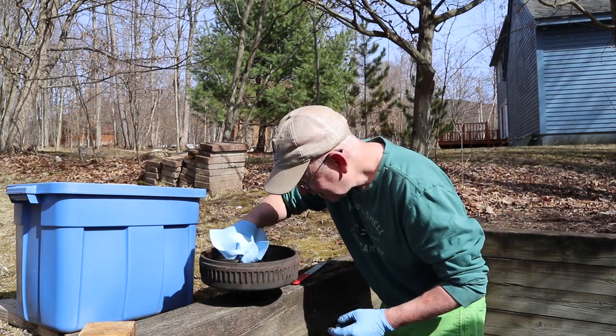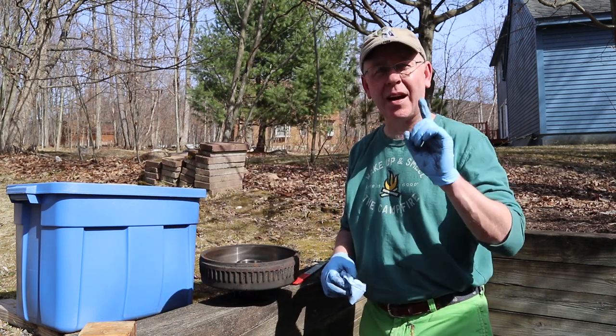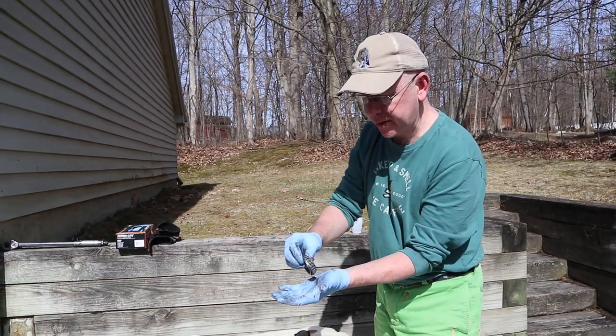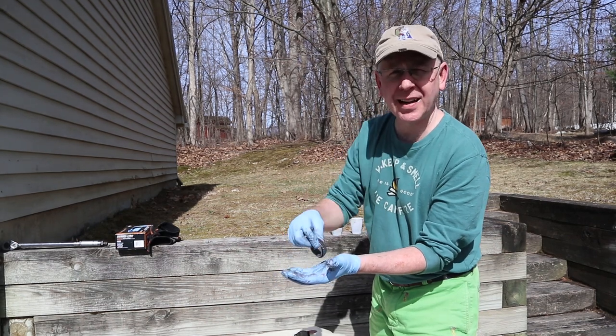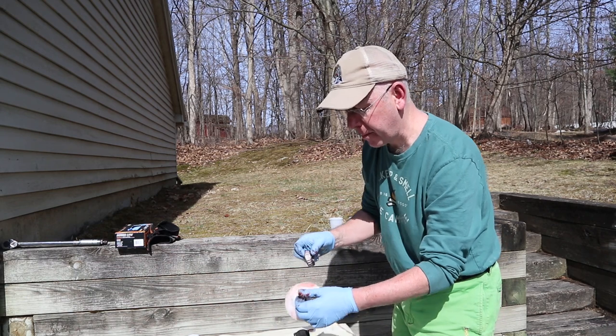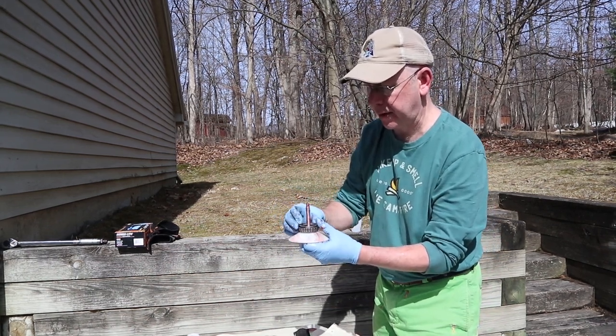How's the inside of the hub looking? It's looking good. You're looking for the race? It's all looking good. All right, now it's time to pack those bearings. Okay, now we're going to actually pack the bearing itself. Some people put a glob of grease in their hand and pack it that way. That's kind of the old-school way. I have this little wheel bearing packing tool, which I think is pretty cool. Can you get one of those? NAPA, any auto supply store is going to have them.